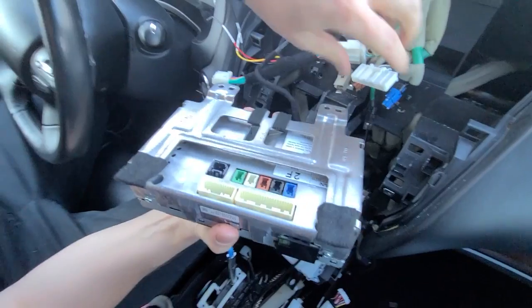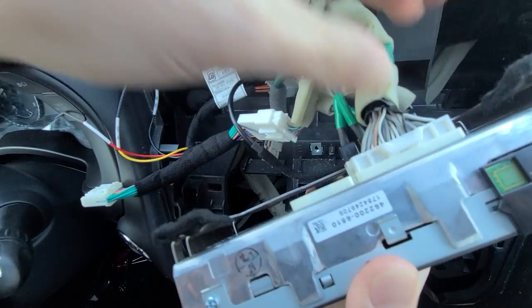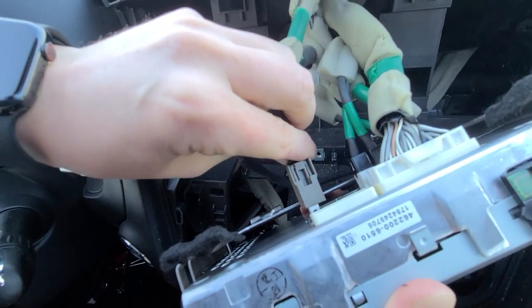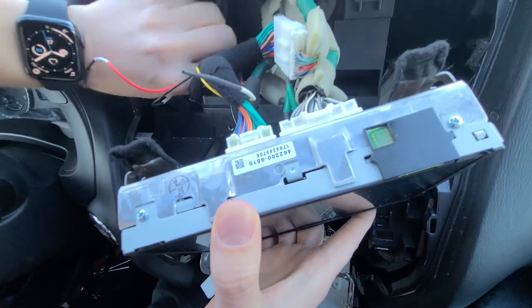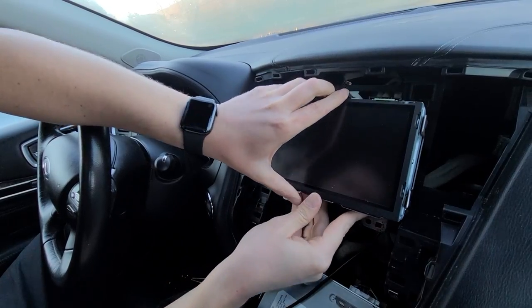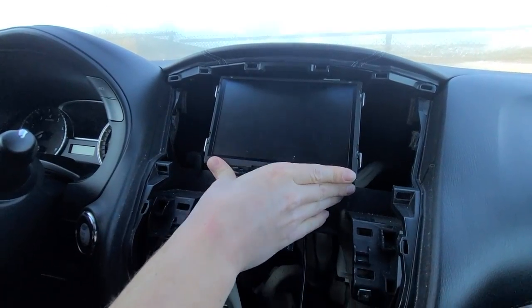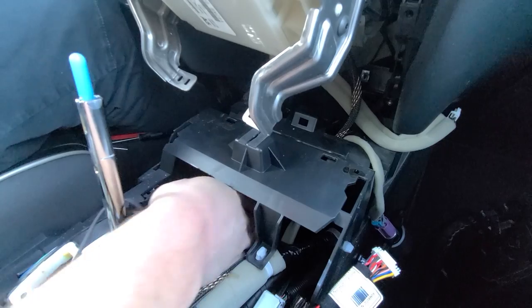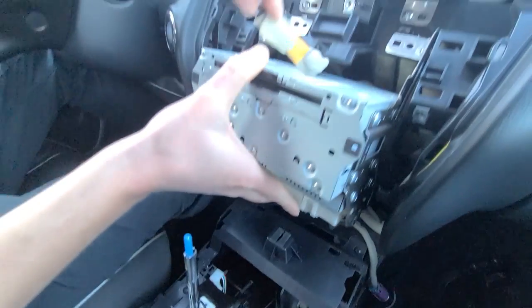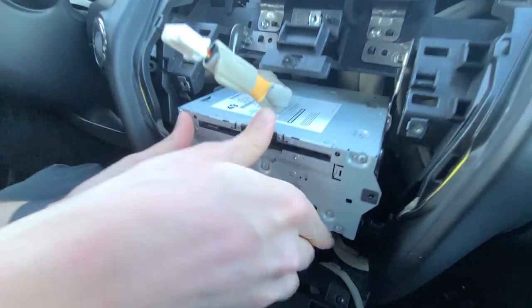At this point you can do the connections. First, connect all the smaller ones — start with the blue one, then this brown one. This is the one that comes with our kit. Now push these wires behind the screen. The top of the screen with the bracket has to go in first, and once it's in, put the two bolts that hold the screen in place. Now continue feeding this video cable behind — here's our video cable. Put the radio back, checking not to jam any wires behind or with the lower brackets. Once it lines up, put the four bolts back.